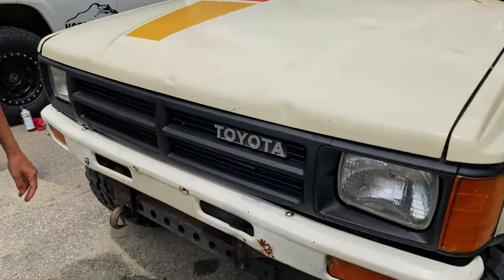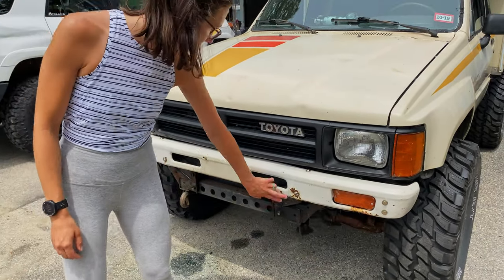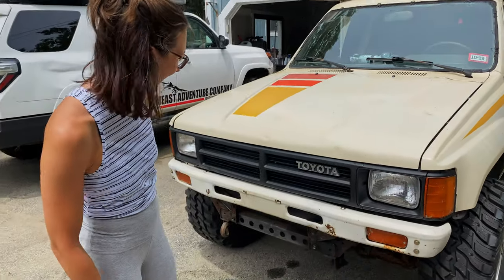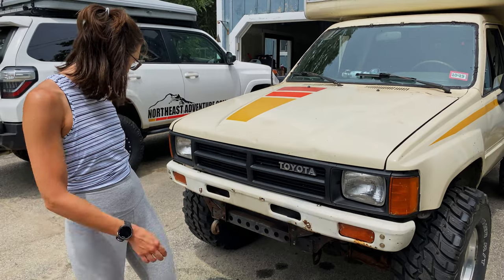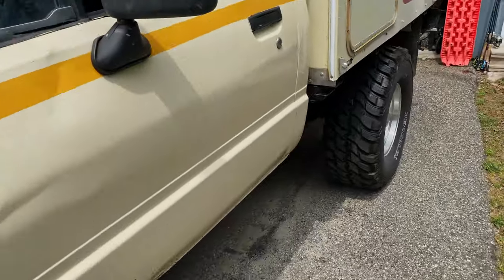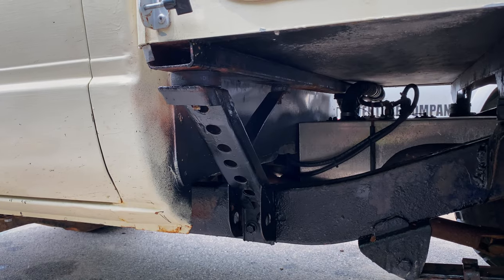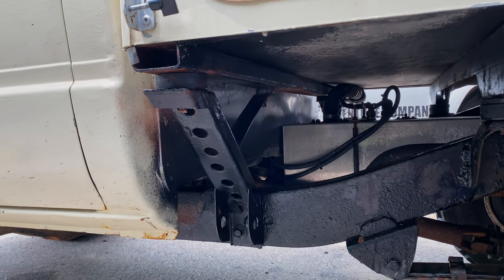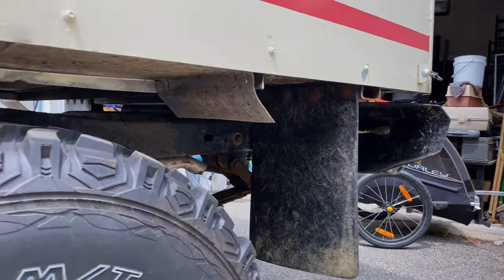Next up, when we get back from our camping trip, we'll pull the rear bumper, strip it down, and reshape it as best as we possibly can — we've never done metal work like that before, so we'll figure it out as we go. Big hammer. It's a little bit lighter than the body, so we'll recolor match it to the body color. Those little things will go a long way to making it our own and chipping away at stuff. I did start some rust prevention — got in there and sprayed it all down with Ospho. We'll let that do its thing for the next week, then when we get back we'll wire wheel it down and start the Por-15 process, doing a section of frame at a time.